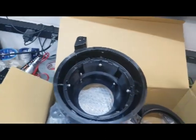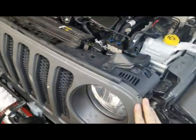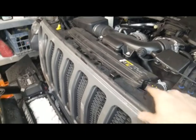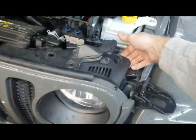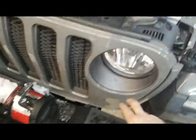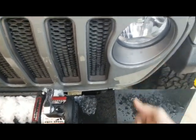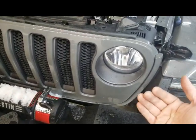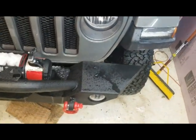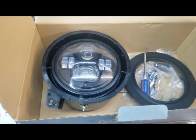The next step is to take the headlights out. You've got to pop your grill off for that - just like a JK. You pull these top little guys, pop them up, pull it out, then lift up on the bottom piece and it'll come out. Then you have a clip here and a clip here - just get your hand behind it and give it a good pop. You're gonna feel like you're gonna break the Jeep, but get as close to the fasteners as you can and give it a quick short pop. Then it's just 10mm bolts and the headlight comes out.